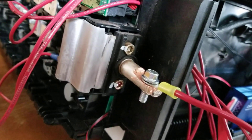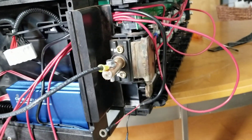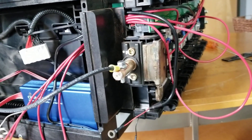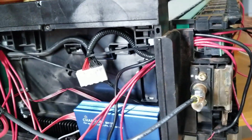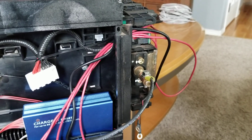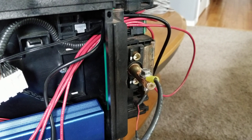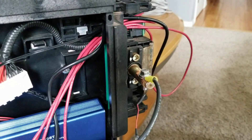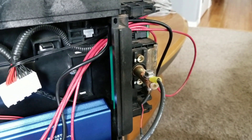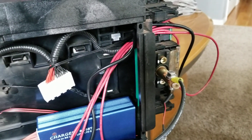First thing I'm going to talk about is these terminals. I've seen a few videos online about them and a lot of people have different ways of doing it, from removing them or putting copper tubes with some pipe clamps. What I decided to do was use a Dremel tool with a cutting wheel, cut them down, filed them down, drilled them and tapped them so I would be able to put a bolt through that. And that's the kind of connection I prefer. Put fuses on there and the like.